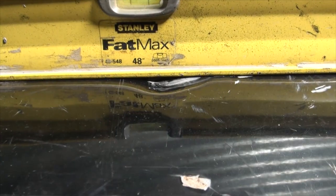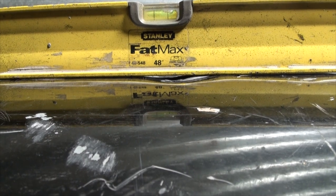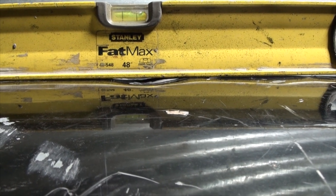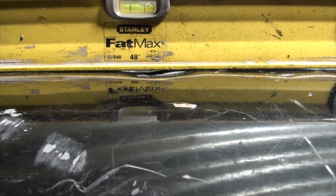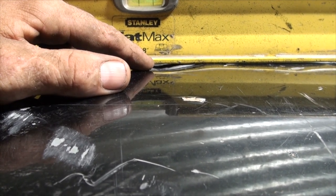It's hard to see the dent now because she's pretty much popped out. What started off as a dent about a foot wide is now only about two inches wide. Use your straight edge for reference - if you can't see any gap underneath, you don't need body filler. Obviously this tailgate has curvature in it, but right now we're just worried about this part. Now we can start marking off our high spots and low spots and knock it down with the grinder so we can start body filler.